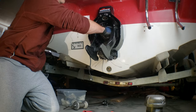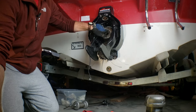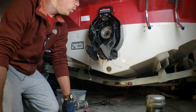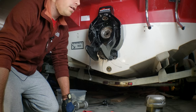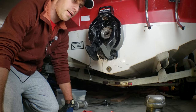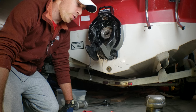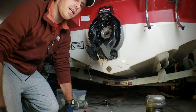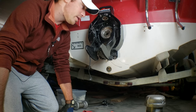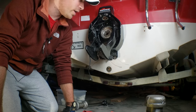It's pretty well squared up now, so at this point it's just brute force. If you're trying to do this with a small framing hammer it's gonna seem impossible, so get something with some weight. One more good hit for good luck — yeah, that's solid. After you get it in there, make sure the inside race is still turning freely and make sure you didn't damage anything. Rent the slide hammer — it makes getting the old one out a piece of cake. Throw the new one in the freezer, give it a little coat of oil — don't use grease, grease is too thick and will actually add friction.